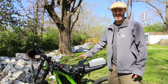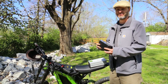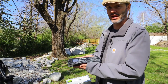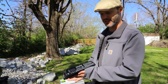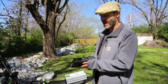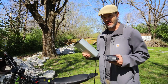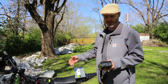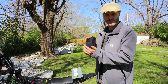The reason I would want an aftermarket charger is so that I could mount it on the bike — primarily something that is fully potted and capable of that. What I chose was the Cycle Satiator, made by Grin Technology, or ebikes.ca if you want to go to their website. It is not nearly as powerful as the stock one — this will only charge at between four and five amps at the output voltage we need for the battery. However, it is far slimmer, so if I wanted to throw this into a backpack, this is far, far better. This is my choice for the aftermarket charger.